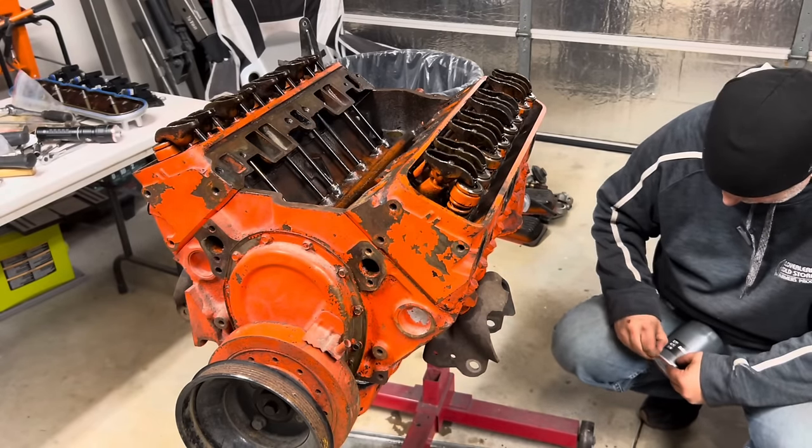You hear that knocking? I think that's that flex plate back there. Oh, the starter is not disengaging. Might need a shim. Maybe we ought to shim it. Sometimes you just need a shim. Dang it. Give me a shim, Jim. Snap it to a shim, Jim. What if we lube it up a little? That's going to sling it everywhere.